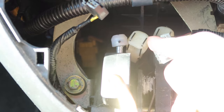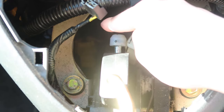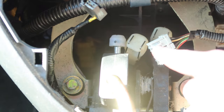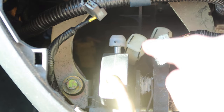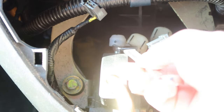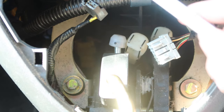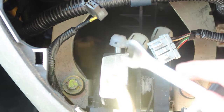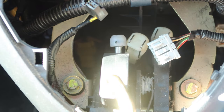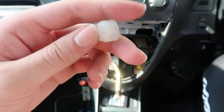With that out, we need to get to this cap. This cap is very difficult to pop off, and if it falls into the transmission you need to take the whole dash out just to retrieve it - and this piece is key to the whole short shifter. What you can use is a 12mm spanner to get up in there and pry it out. Try to get underneath it and just pry it - and boom, there's the plastic cap.